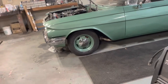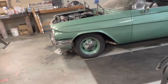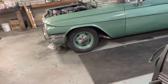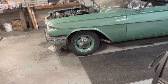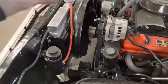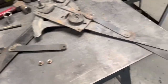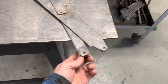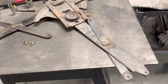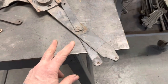My clutch was wrong, so I was out the original money I bought for the clutch. I went thinking it was a throwout bearing and bought another throwout bearing — I can take that back. But I had to buy another clutch kit. And the power steering hose — I probably had $50 in that and it was a complete bust, so I had to do another power steering hose. So yeah, if I can save a few bucks on window rollers, you're darn right I'm going to do it. This roller's completely broken off — I'm going to cut this off, push this through there, and put a little spot of weld on the back.